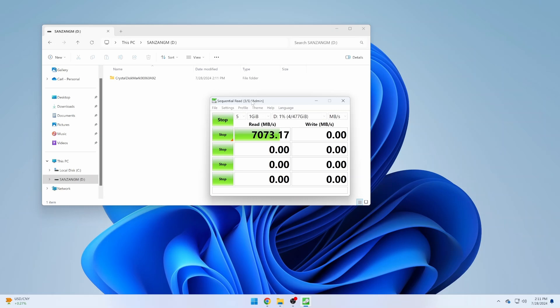Right off the bat — you can actually see it is reading at over 7,000 megabytes per second, and the write speed is over 5,000 megabytes per second. That is huge. I'm going to run the test one more time because the thing that can actually slow down NVMe drives is the fact that they get hot, and this is a very intensive test. It looks like we're still up over 7,000 megabytes per second, which tells me that the heat dissipation from the heat sink is actually helping out a lot. I just wanted to give that follow-up test.